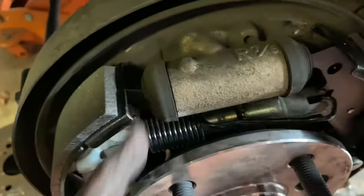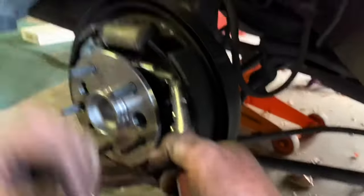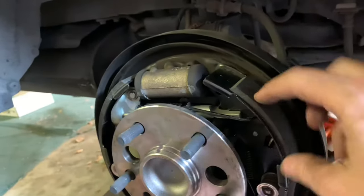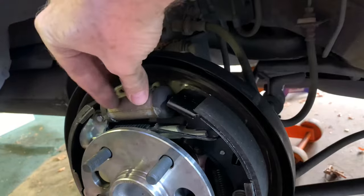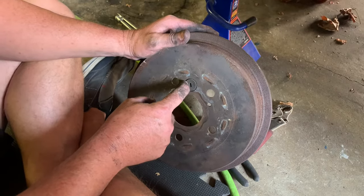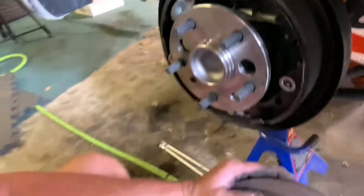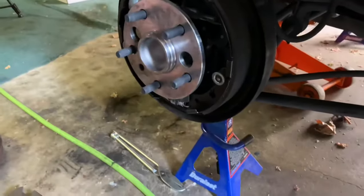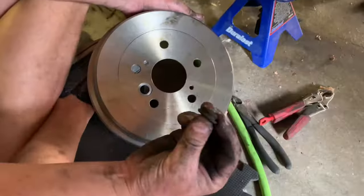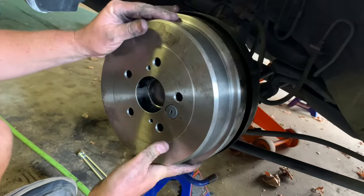You want to make sure that these things stay in the middle. Grab this and put it over there — all right. So that was a lot of work: vice grips to pull the spring into there, and we also pressed a little bit to push some brake fluid back up the line. There's a little rubber piece — you've got to take it off the old one and put it in the new one. What that does is allow you to adjust that little wheel in or out if needed for the parking brake. You could also have the old rotor turned and resurfaced, but we opted for new ones since we don't ever want to do this again. Put the rubber piece in right here so the rubber hole is in line with the hole on there.